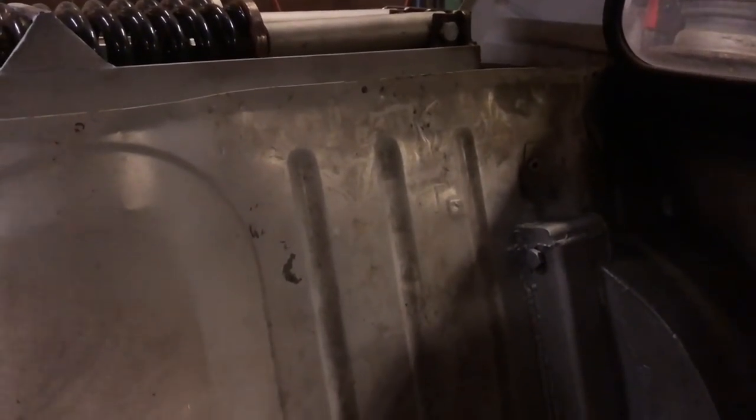I think it shouldn't move too much anyway, but even so, if I can get them bits braced up. Obviously I've got this hump to come across, so the rest of the seat back's pretty flat until you get to this point here, and then it starts to raise forward. So what I plan to do is measure up between there, and actually cut that section out and then sink the bar into it. I think I've got some 2x1 box section I'm going to do that with.